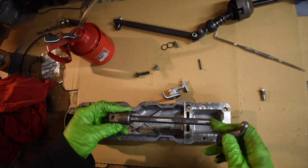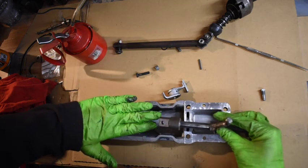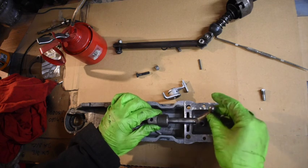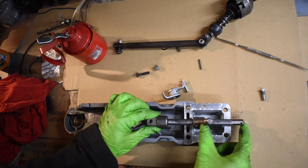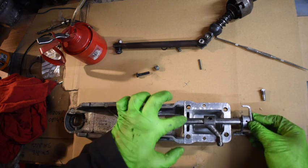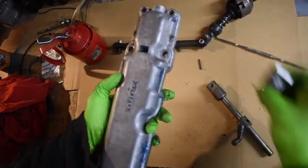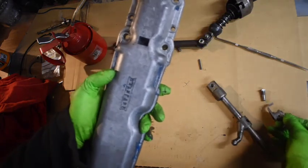This is looking symmetrical - it should be symmetrical. This goes this way round. We've got this other bit of the linkage sitting in there, and it's parallel to this plane. We need our shift finger - this is the bit that actually goes into the internals of the gearbox and engages with the top cover and makes the shift happen. That needs to be in the middle, in neutral. We've got this cam here - that's got to hold this cam. The overdrive switch is on the right-hand side of the gearbox facing forward, so the flat side faces in. Makes sense.